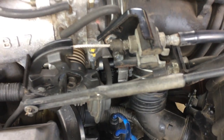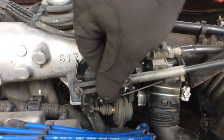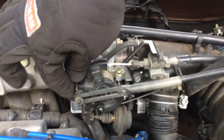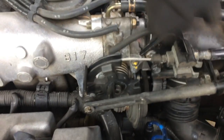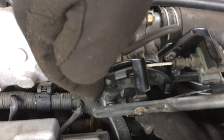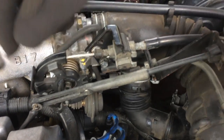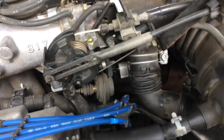Depending on what kind of cruise control you have, you'll have a pin and a washer clip here, and you'll need to take this 10-millimeter nut off so you can remove this retainer. Then remove the two 10-millimeter bolts for this throttle cable bracket. At that point you'll be able to move the throttle back — with the retainer out of the way, work this cable off. With those two bolts removed and the bracket out of the way, remove the cruise control cable from the bottom, and then this unit comes right off.